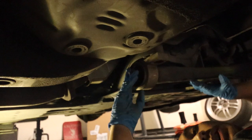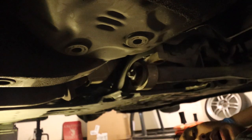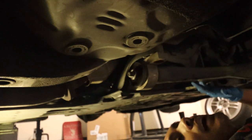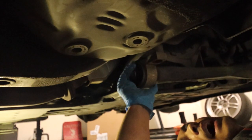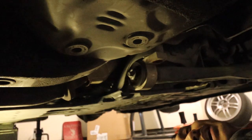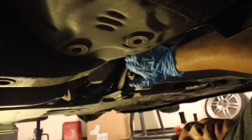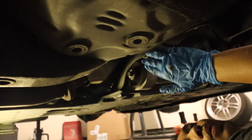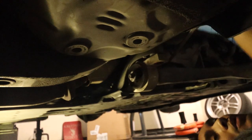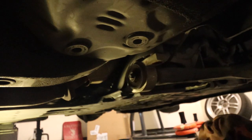I got all the bolts off — from here, here, and the bracket as well. It was a little difficult because I don't have a lot of room to operate and these are bolted down pretty tightly. Let me see if I can take this out — I can't just slide it out because it's blocked by the frame here. I'm going to flex the lower control arm a little bit and see if I can slide it out.